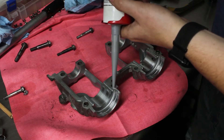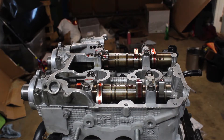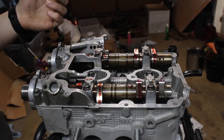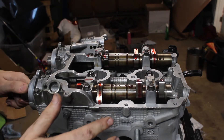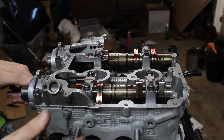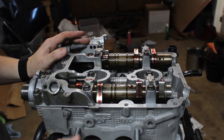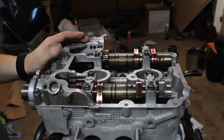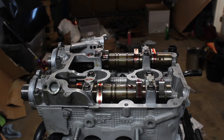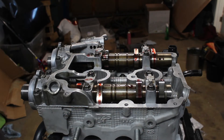New valve buckets were in, so I installed the cam caps and checked the clearances again. After a while of swapping around some of the old ones and putting new ones in, the clearances are okay. Some of the exhausts are kind of tight on a 13-thou feeler gauge, and that's about as low as they're supposed to be, but it's in spec. I wanted to run slightly higher exhaust clearances — I bought buckets that were supposed to be shorter to make a larger clearance — but even aiming for the middle of the 14.5-15 thou range, I was still at 13 for the exhaust. Maybe they'll wear in just a little bit and increase those clearances a bit.